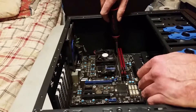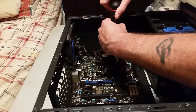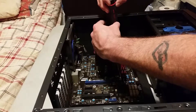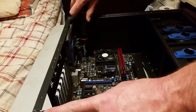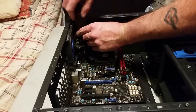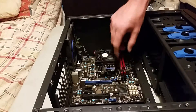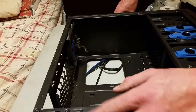I wish I had a six-inch extension bit for this one — this is a little bit of a tight spot here beside the RAM slots. There we go. Should be one more screw right up here in this corner. There we go. Now your motherboard should, with a little bit of a wiggle, pop right up and pull completely out of the system.